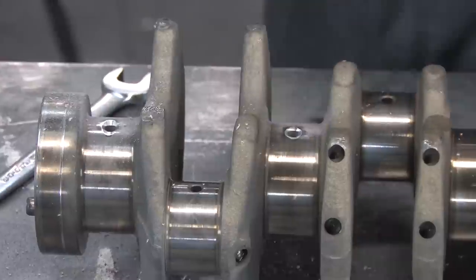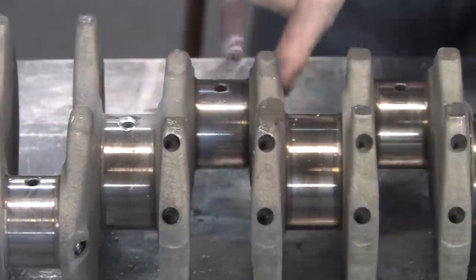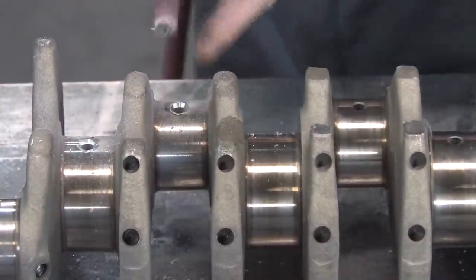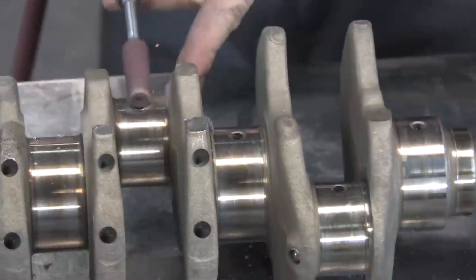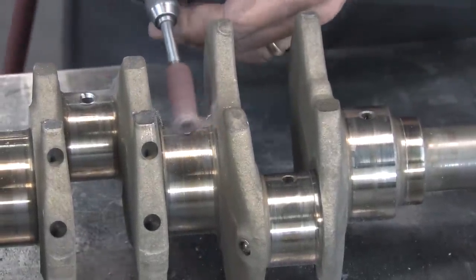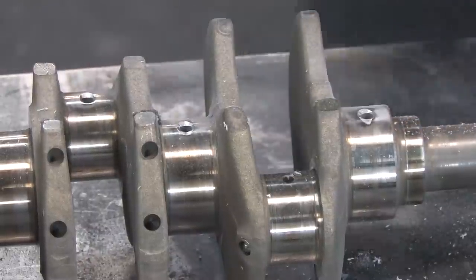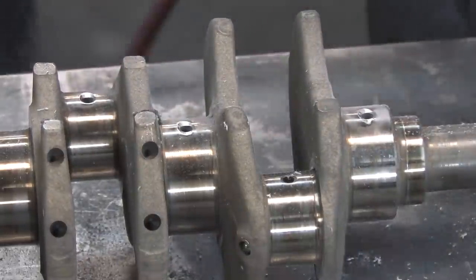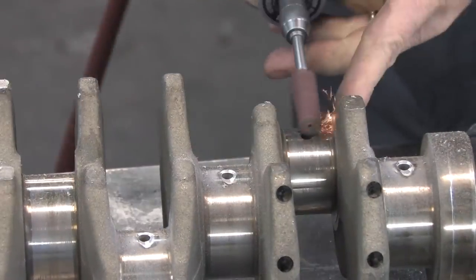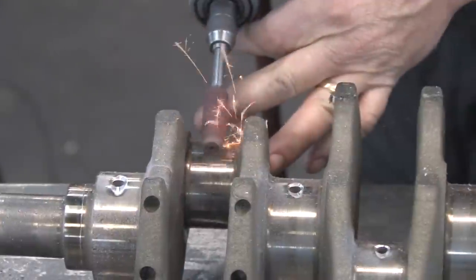As for my setup, I'm not really worried about making them directional and I don't care to micromanage this part of the build — simply enlarging them is an improvement in my case. My engine will be going back together without balance shafts, and the block's oil pressure will be increased as a result because of the blocked off oil holes that used to keep the balance shafts oiled. I'll have higher oil pressure in the bottom half of my engine as a result. I prefer doing a full chamfer on the rod journals to relieve some of that extra oil pressure. My rods will be set up a bit on the looser side and they're very heavy, so they can benefit from that oil flow. This is where I want it to go.